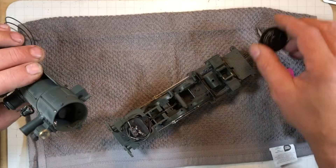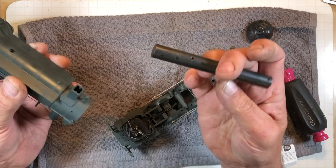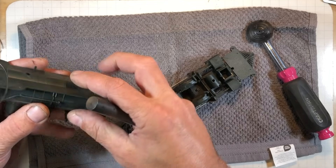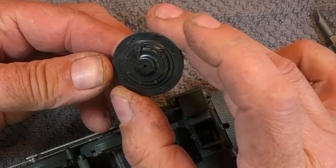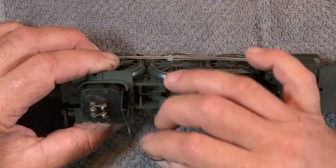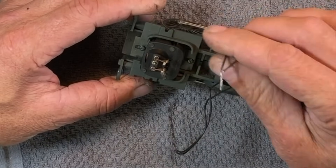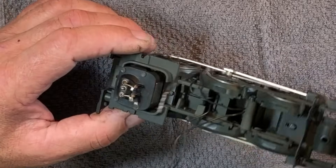What do we got in here? Whoa. That's supposed to be screwed down — looks like it would screw down right where that went into. And there's another screw right there. That boiler cover is completely black. What's going on in here? I want to know why she didn't run. Well, that'll do it right there. That motor is not hooked up. No electrical connections whatsoever.